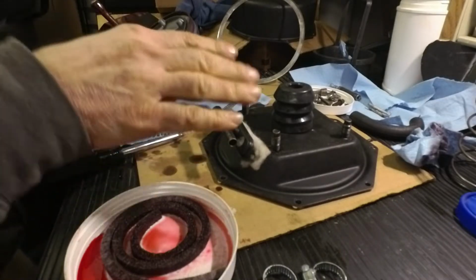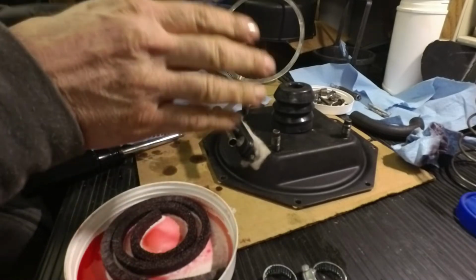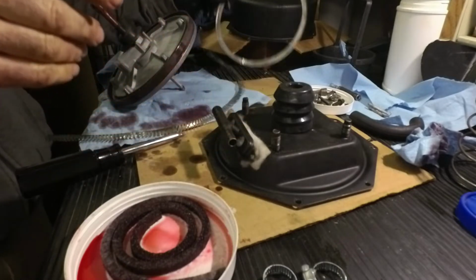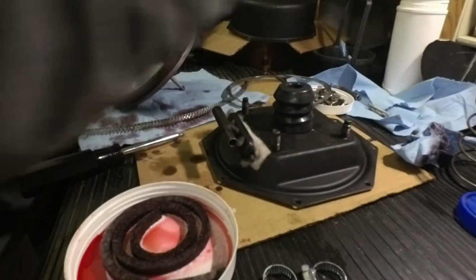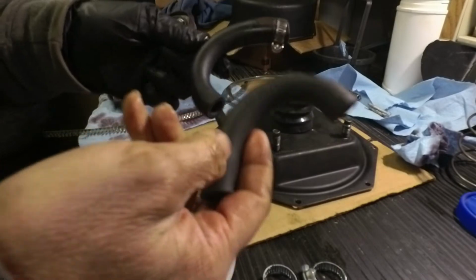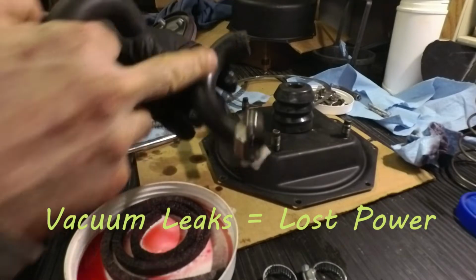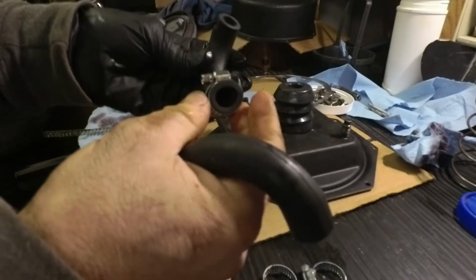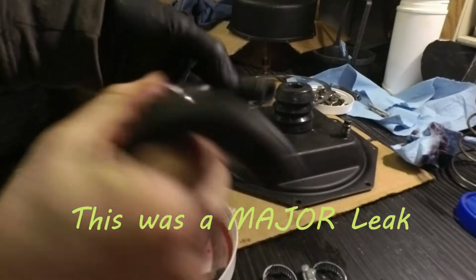Okay, what I'm doing here, I'm putting together this brake booster. This is what sidelined the 1960 Pontiac Bonneville in the first place. So I took it apart. It wasn't working properly, mainly because of this. Whoever assembled it, it was cleaned up, but automatic transmission fluid got all over this hose, which it shouldn't. So you can see it's all dilated. And then just putting the clamp on caused it to tear there because this hose constantly moves.